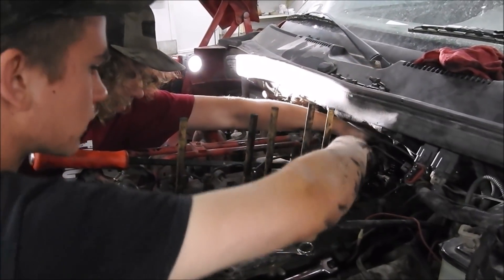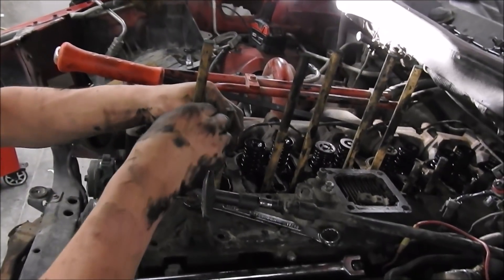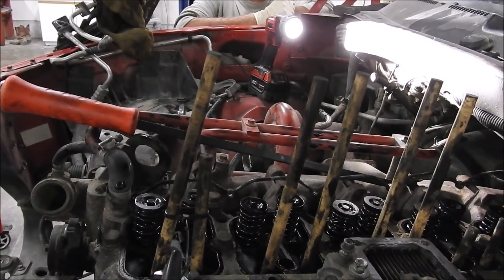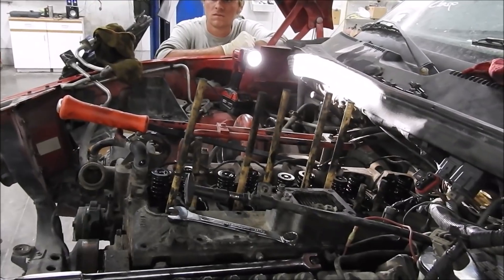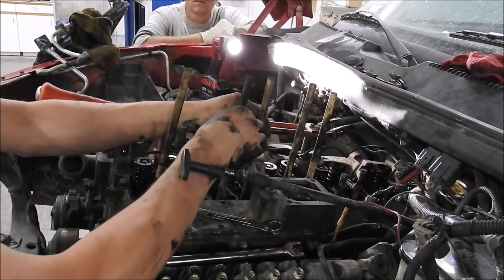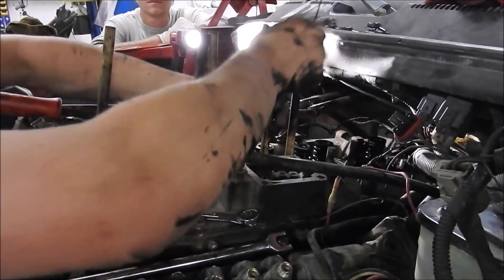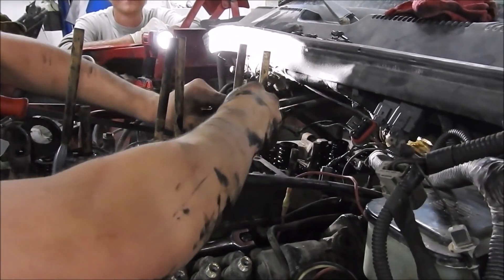So we tap the wooden dowels down into the lifters — that's what we're doing here. Pull them up as far as you can and pull them tight. To get them out you just yank them up. Once the camshaft is pulled out and everything is pulled off, shove the cam back in, then pop these out and the tappets will fall back down on top of the cam. If the cam's out and they fall, they'll drop into the oil pan and you'd have to pull the motor — not a good day. Use good wood, fellas — it makes all the difference.